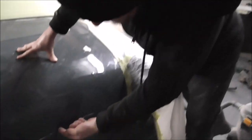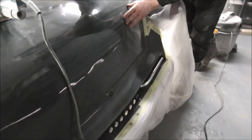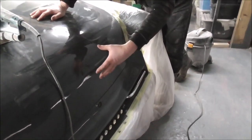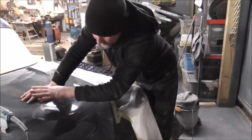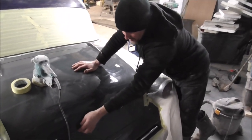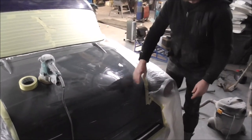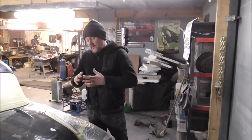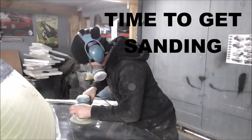This is not as bad as the roof but it definitely needs some attention. On the boot just here we have this large crack, and there has been a lot of body work done in this section because we took out the recess for the number plate and the large light that went over the number plate to give it a smoother look. So what we'll be doing is probably 40 grit this back and then covering this whole area in fibreglass, as at some point it's flexed and that has led to that crack - so we'll actually be strengthening that part up.